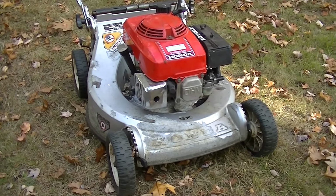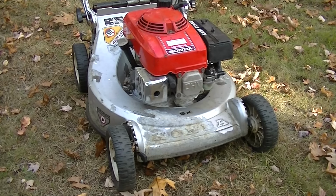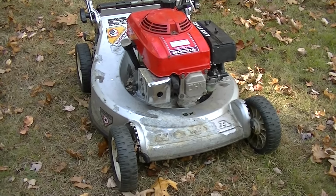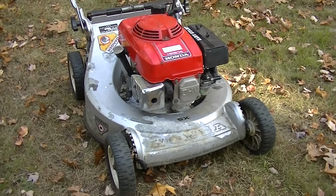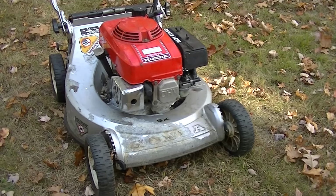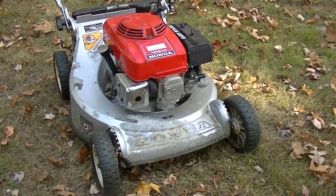What we're going to do with it right now is let it cool down. We'll start it up again, and we will see if it smokes. Also, I brought down the oil level to under full capacity to see if that helped at all. I also thought about the breather from the overhead valve to the carburetor. First, I was thinking if it's clogged, maybe it'd be a problem, or if that's pumping oil into the carb. How it would do that, I'm not sure.